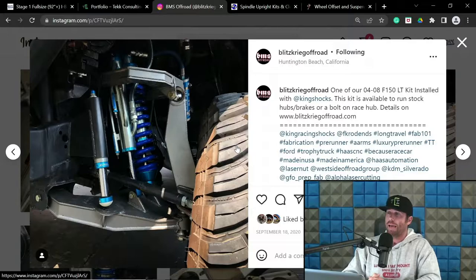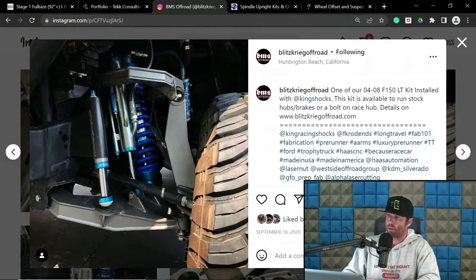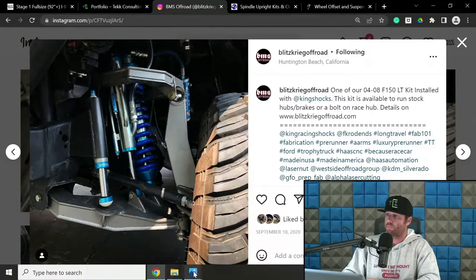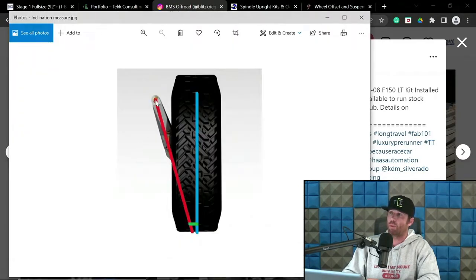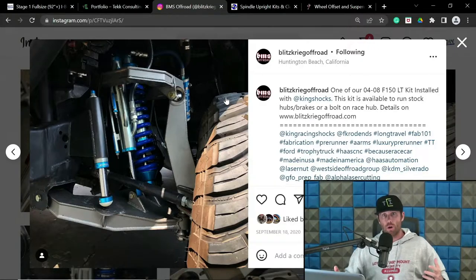you are, in essence, wanting to control the camber curve as best you can, and you can't really change the chassis pivots. So you're forced to manipulate items like the scrub to bring the upright a little bit more straight up. So in this diagram, you're moving this point right here closer to the tire. So we're gaining a little bit more of the upper arm length without changing the chassis widths. And so in doing so, you're going to increase that scrub.